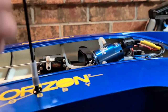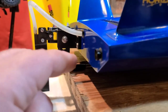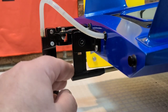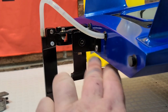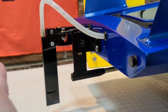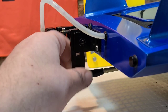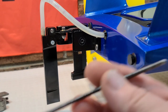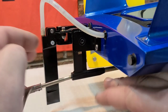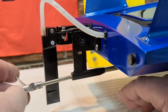The stuffing tube is a little long on my boat. Not all boats are made the same. Your stuffing tube may allow you to put some down angle on your strut from the factory. I can't get any down angle on it — once I put some down angle, it wants to push the top of the strut arm out and we can't get any adjustability. I'd rather the stuffing tube be a little long than a little short.